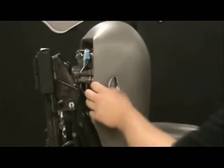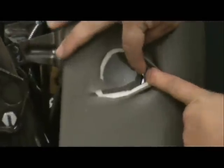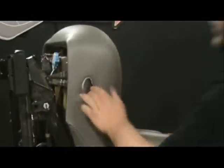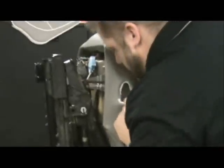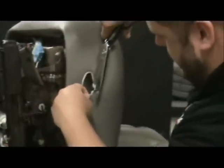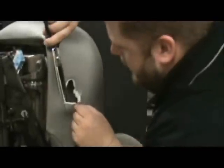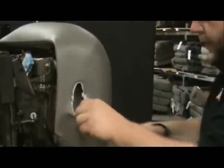I usually start with a little oval here, and then it gives me a little window inside of the seat. Right here is the bottom of the frame, so I don't really want to cut below that. I can pull this side up here and now I can see the top frame — I definitely don't want to trim any higher than that. There is a little bit of forgiveness here because the plastic paneling does cover up some of it, so if you do cut a little bit more, you're not dead in the water. You do have a little bit of cheat room. But you want to try to get as close as possible the first time. I'm going to look through the window and see how far down I can go, just start trimming a little bit at a time. I usually get about an inch or so, then cut that off and reassess where I'm at.